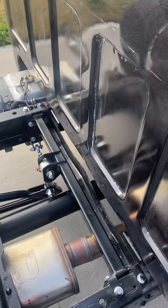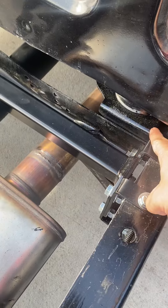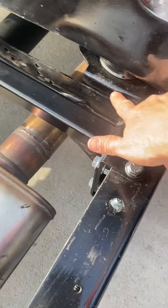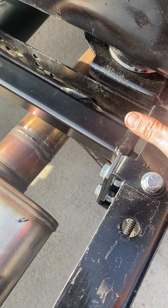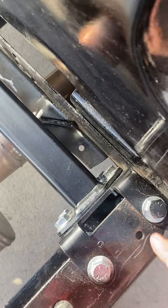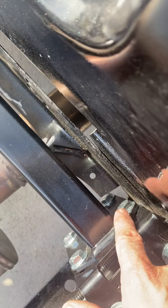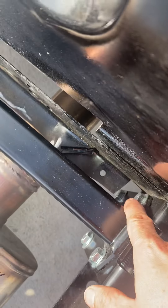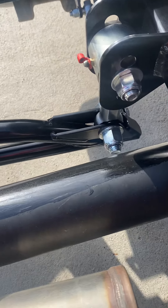I think the hardest thing I encountered was this measurement — it said eight inches, but I thought it was eight inches from the front. It was actually from the back. So you measure from the back eight inches; basically it just goes against the fuel rail. There is a notch that you have to do — remove it so that you can have clearance — and you can see where I notched it. But everything else is pretty easy.